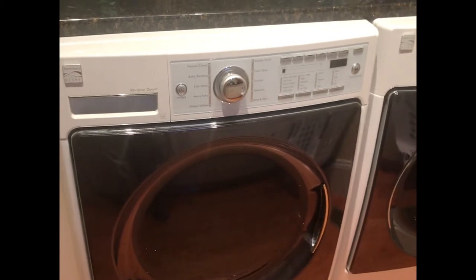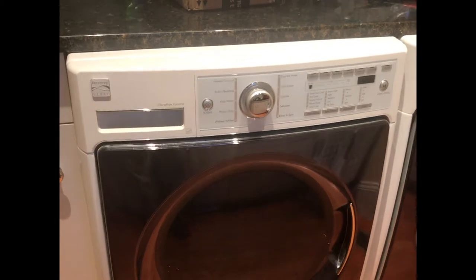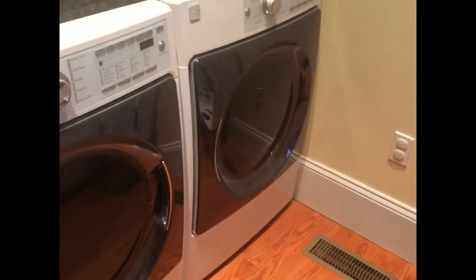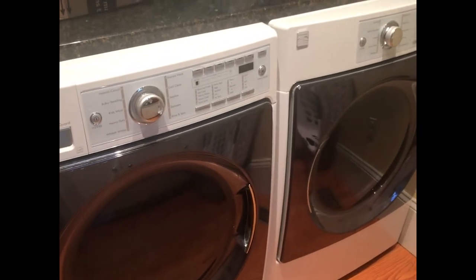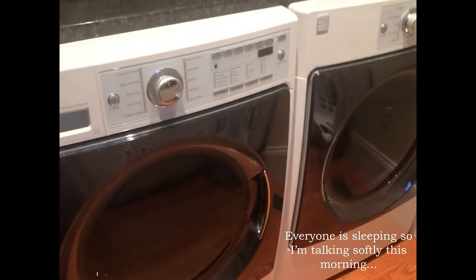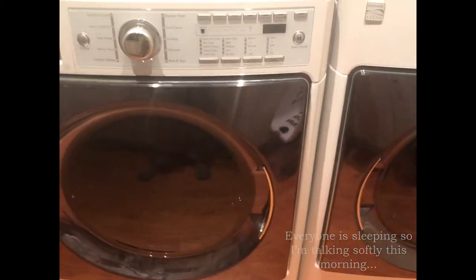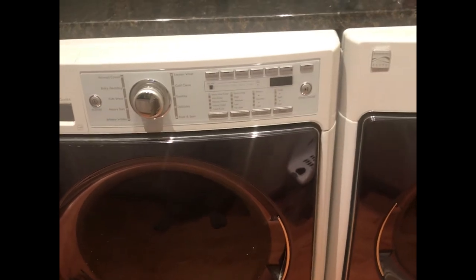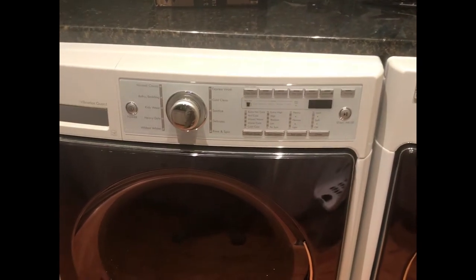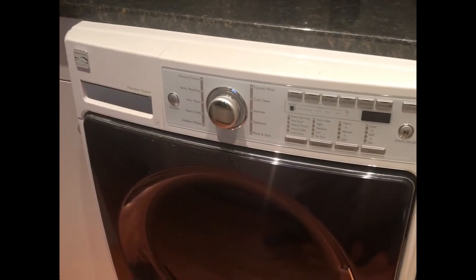On our farm, we run two B&Bs, one on the farm and one away from the farm. And a big part of that is cleaning the laundry, the towels and the sheets. So we had a problem with our Elite Kenmore washing machine. We're getting the OE code, which says the drain pump's not working. And we tested it by going into the test or diagnostic mode. And as a result, we think we got to replace it.